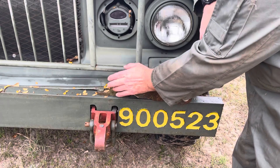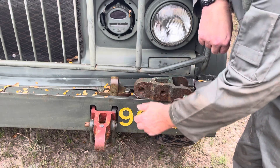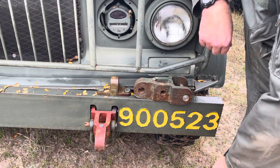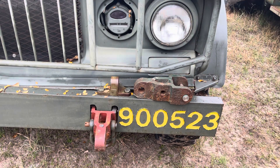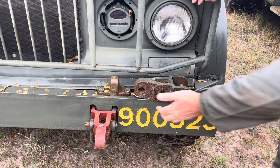I added these to the bumper — this is not stock. The bumper is six-inch channel iron. I made this bumper because the stock bumper on the 715 is total junk. It is super-thin stamped steel that bends if you look at it wrong, and it wasn't on this truck when I got it. If you're going to tow-bar one of these trucks — the 715 — have the bumper.